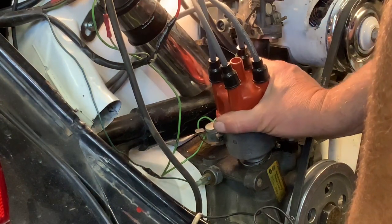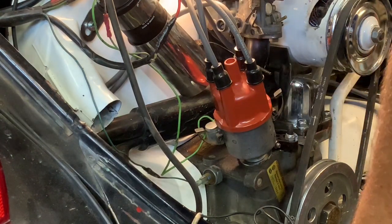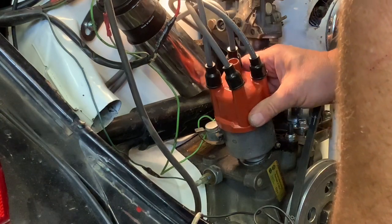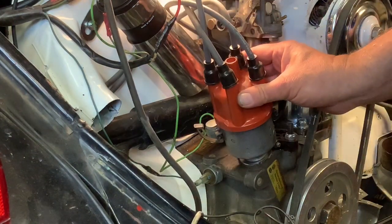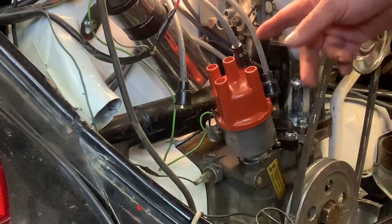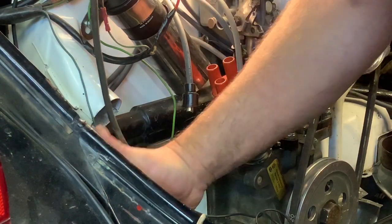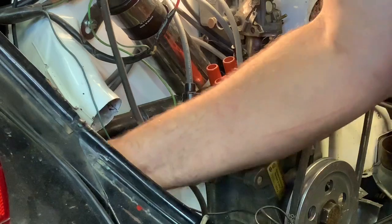So now I have this sparking almost exactly where I want it to. When I pull the distributor cap off, it's pointing 180 degrees out. A lot of times you could take and turn this, but what I'm going to do is just move all my wires around to make sure it goes the right way. So I've moved number one to right where it's supposed to be firing. The firing order for this is 1-4-3-2. I just love these VWs — they actually name the cylinders right on the fan shroud. You can see that's number two; number one is back there. Right on the shrouding they give you the actual number.